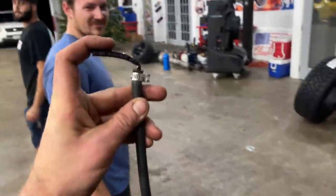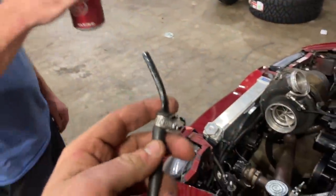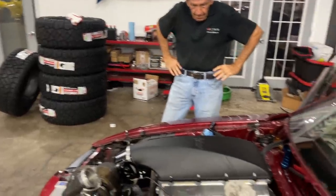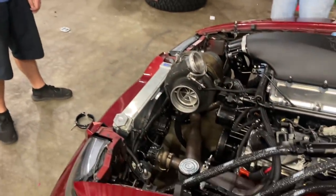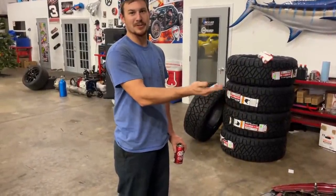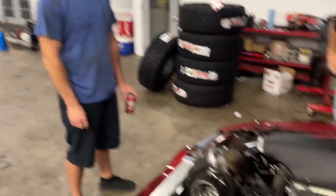Zach, you led us in the right direction — the line was kinked at about 90 degrees, and that would be the reason why we aren't reading any boost. So let's get her right. Without fixing this, the boost controller would keep trying to add more boost thinking it's not getting it, eventually locking the wastegate shut. Glad we found that issue.